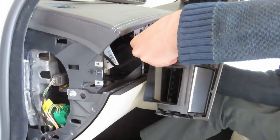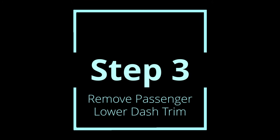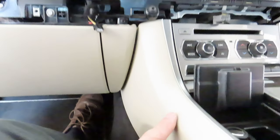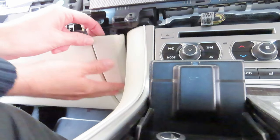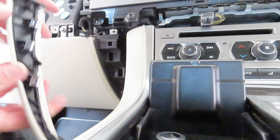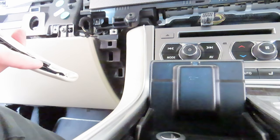Using our trim tool, pull it away from the edge of the dash. Once you have this off, just press down on the tab and you can release the register's plug. Once you have this piece off, you also want to remove the trim in between here because we want to get in there to bring our USB cable and our auxiliary cable through. So we need to undo that T20 over there, and then this thing just unplugs and pulls up. You can see there are three little plugs that hold this in place and there are locating pins down there.